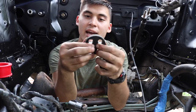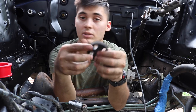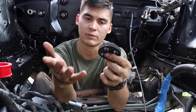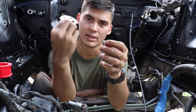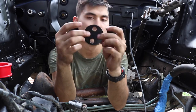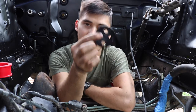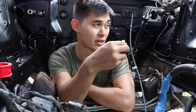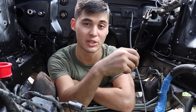Now that we have the steering column bushing out of the firewall, I wanted to show you guys the differences between the two and why upgrading to an aftermarket one is a worthy upgrade for your 240SX. The OEM piece is made of rubber - there's a bit of play in it, which is good for soaking up vibrations and gives a comfortable feeling. But that's going to give you a bit of slop. We're upgrading to a full metal solid steering bushing which has no play and is going to make our steering a lot more direct, more responsive, and more precise. It's a very cheap and easy upgrade - all you have to do is pull the steering column out of your firewall and install this with four little bolts. You can also access this bushing from the interior of the car - FR Sport does a great write-up on this.